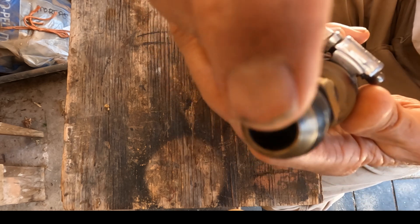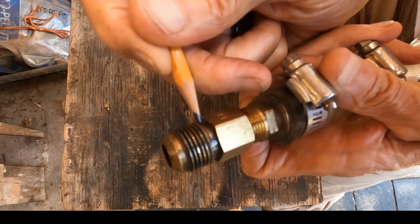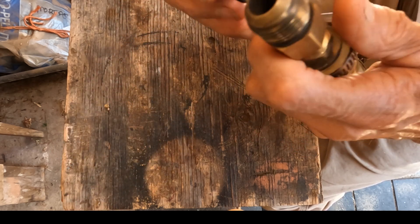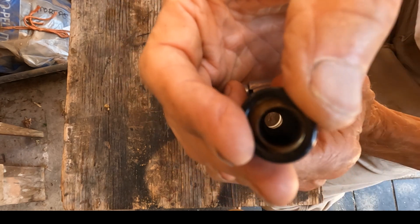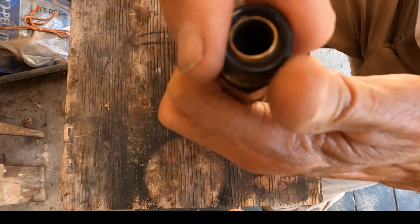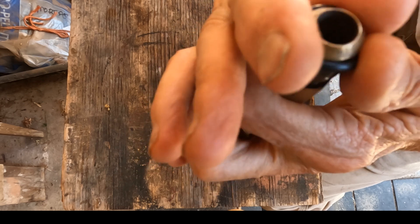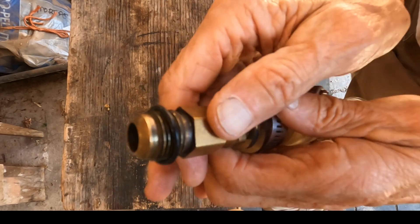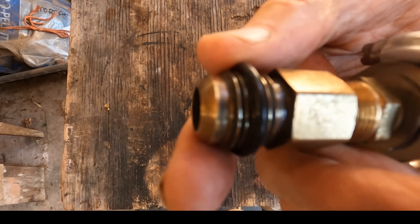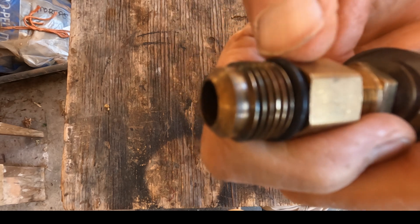Here's my opening and my lip, and then the threads, and then in there — that's the gap. Here's my O-ring. If I put the O-ring right on the top here, I see it won't fit at all. I need to take my fingers and stretch this O-ring out and roll it. Now the O-ring is stuck on the threads, it's expanded — and watch what happens. I'll just roll the O-ring down and boom, it seats inside the gap.